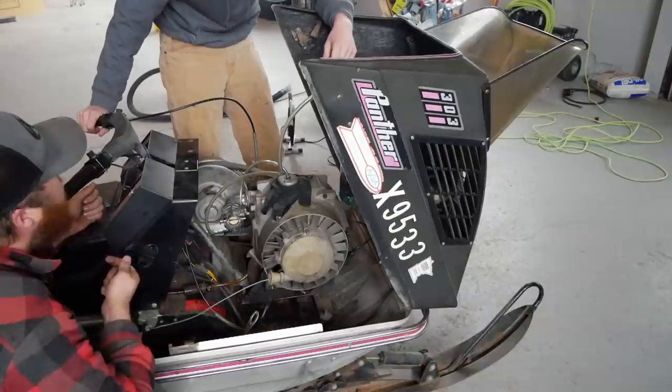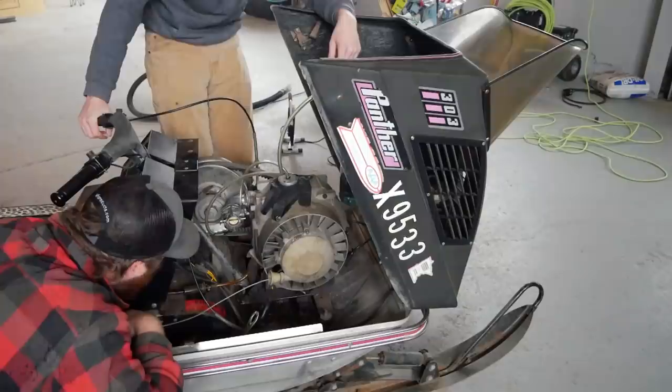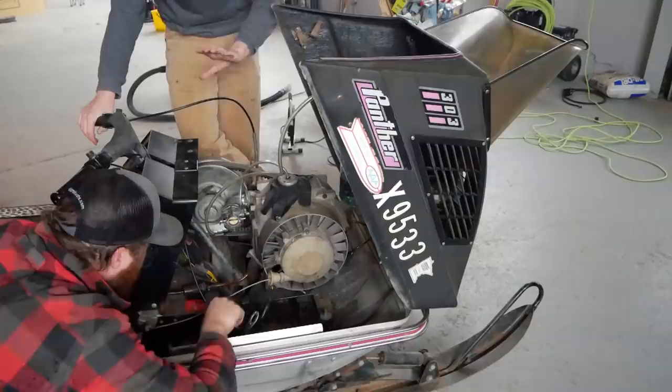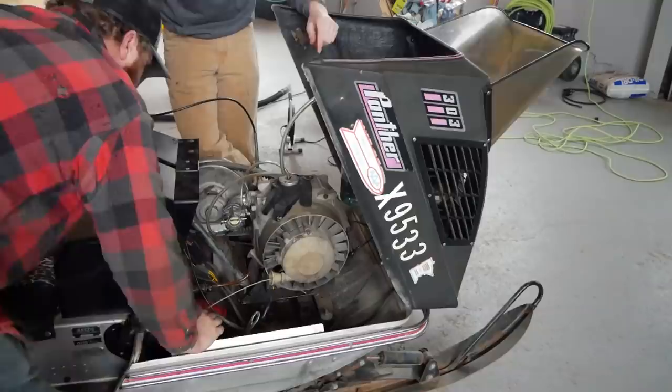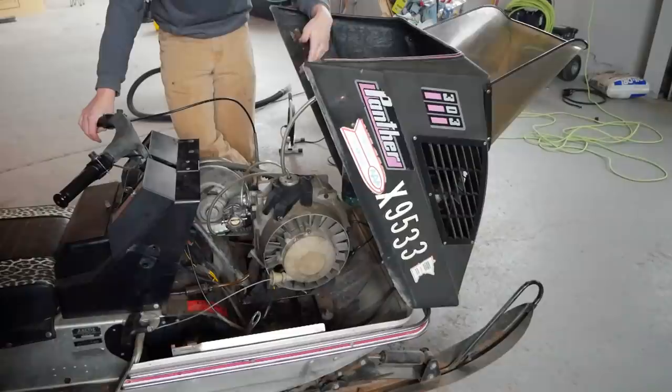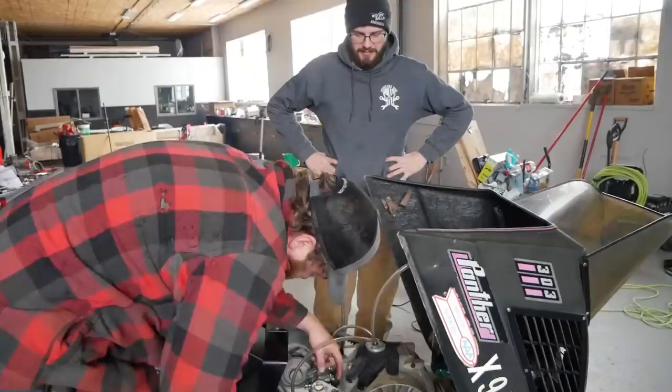See if it'll just move 8 feet and then call it good. I don't know what the hell's going on. I'm starting to think that this motor's really sensitive to pretty much anything. Because like you pointed out earlier, the entire front and rear surface of the rotor housing could be a potential vacuum leak. This whole motor's a head gasket. Yeah. So if there's anything wrong with any of those seals, it's pulling air. There could be something wrong with this carburetor still. It's got 3 different seals before it even gets to the motor. Any one of those could be an issue. Well, you win some, you lose some.